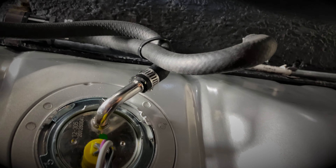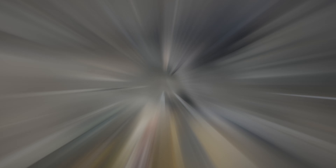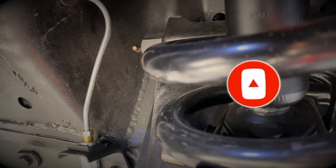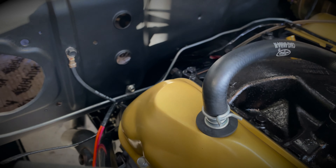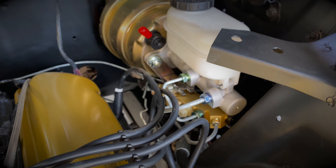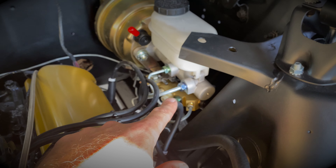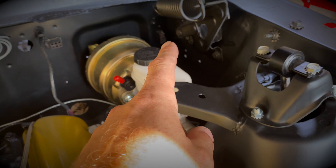Here's what I came up with — I've got it coming out of the tank to the inside of the fuel filter, coming out to the hard line. I went ahead and threw a zip tie in here just to make sure the rubber doesn't rub on this hose clamp, and looking at the hoses they're not rubbing on anything else, so that should not be an issue. No kinks in any of the bends either — it should work out pretty well.